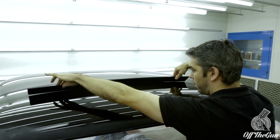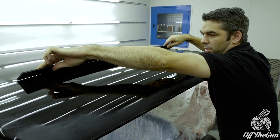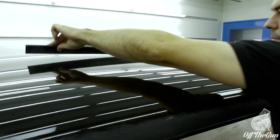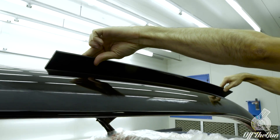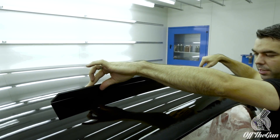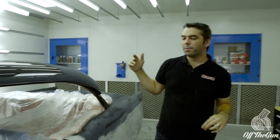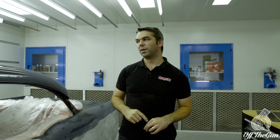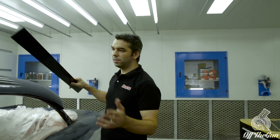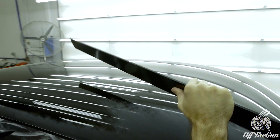You can see here — all we do is drop the spline over the car and put a little bit of pressure towards it, and the spline naturally takes to the curvature. In some areas it lifts off the surface, in some areas it touches. And ultimately, there are high and low spots. Different sections of the car will have different amounts of curvature, and it's up to the user to decide where you want your flats, where you want the curve to accelerate, roll off. That edge or surface the spline presents is what we're aiming for. If it's in metal we can choose to do metalwork; if it's in filler we can wipe in more filler. We can use this to identify what we want to do — low there, high there — put some sandpaper on it, make the adjustment and correct that surface.